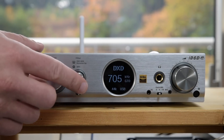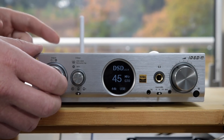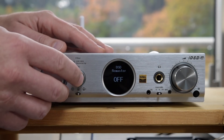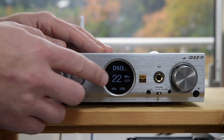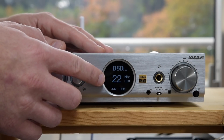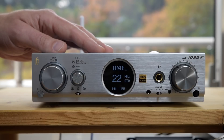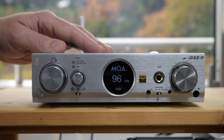After those filters you can also have DSD upsampling. You can either have DSD 512 or DSD 1024 upsampling done in the FPGA built into here. The output then indicates 45 MHz for DSD 1024 or 22 MHz for DSD 512. The DSD processing happens after the PCM filter is applied to the input music. The filters in general will not be applied to DSD input, and the other thing they won't be applied to is MQA — MQA bypasses all the other filters entirely and is output only through the built-in MQA filter.